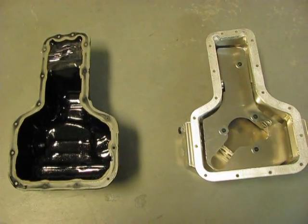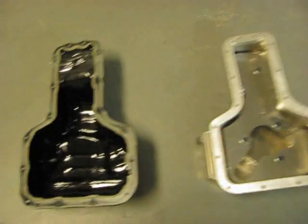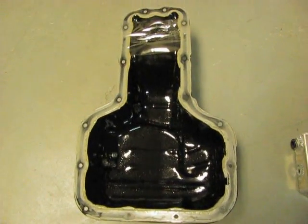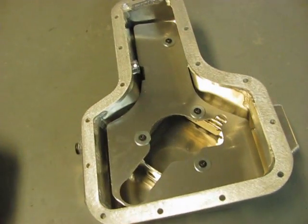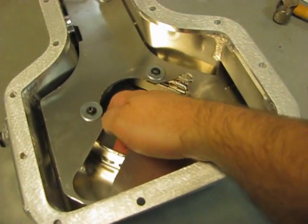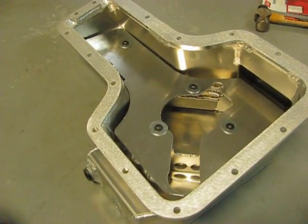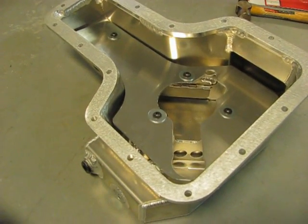The OE oil pan is being replaced by the Moroso oil pan. The difference is the OE oil pan has no baffles — nothing to prevent oil from sloshing around, just a couple of ridges in there to slow it down a bit. Whereas the Moroso pan has a baffle plate and a box around the oil pickup with trapdoors. What this does is keeps oil close to the oil pickup so that in high-G corners the oil pickup won't suck in air, which causes the oil pump gears to explode — or at least that's one of the theories.